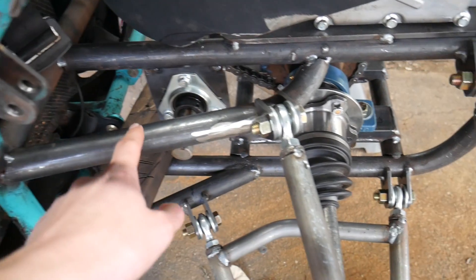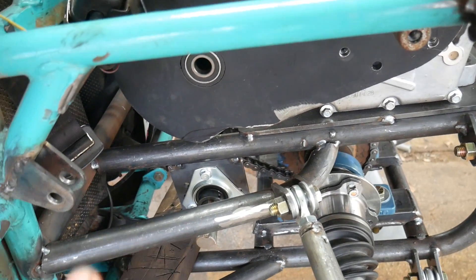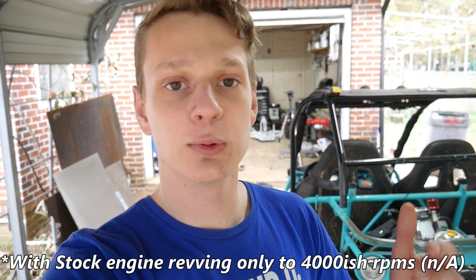We did get the jack shaft tack welded and I'm thinking I'm going to scoot it back a little bit farther, but I just wanted to check and see how everything moves. A jack shaft will be absolutely necessary for this build — it's going to let us run crazy gear ratios for crawling. I'd like to make a high and low mode in the future, which I'll show you in a couple videos from now. When I had the 22s on there, it topped off at 40 miles per hour and it would power slide and drift like crazy — that was at 6 to 1. We're going to be running 9 to 1 with bigger tires, so we should see around 35 miles per hour maybe. My main target is just going to be 0 to 20, occasionally might be able to hit 30, 40, 50.